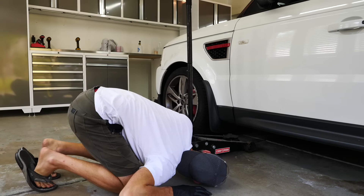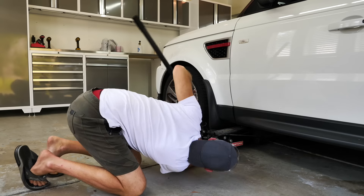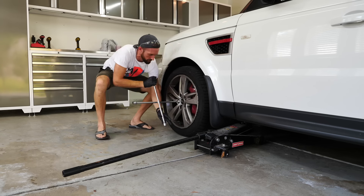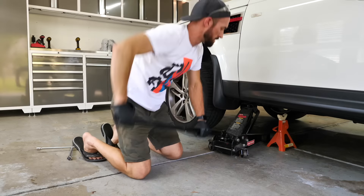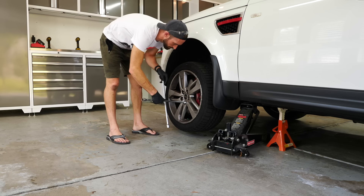The first thing to do is get the wheels off the car. You can do them on the car, but I prefer not to, just because of the overspray when you paint them. It's always best to remove the wheels and do it that way. When you do jack up your car, make sure you use jack stands and proper safety methods to support your vehicle, then remove the lug nuts and get those wheels off.